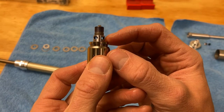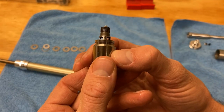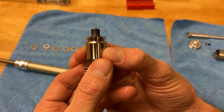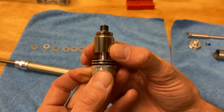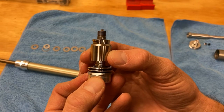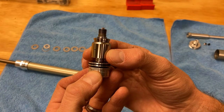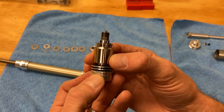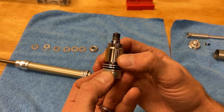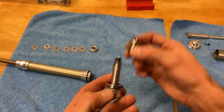These ports allow oil flow through the cartridge and out around this valve, so this acts just like a lockout — no different than a lockout on just about any other fork. The valve is supposed to sit here and close off the ports. What happens is as time goes on the spring gets weaker from having mass sitting on it and being compressed, and the valve might only close to this point rather than shutting off all the way at the top where the valve covers these ports. So if it doesn't completely cover the ports, you're going to get oil flow through it.